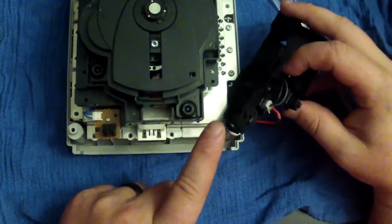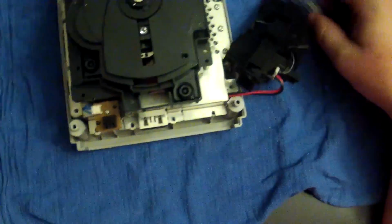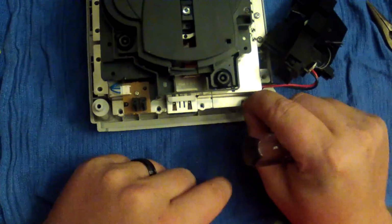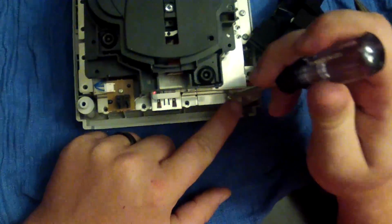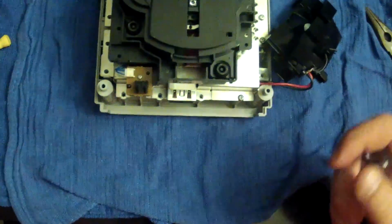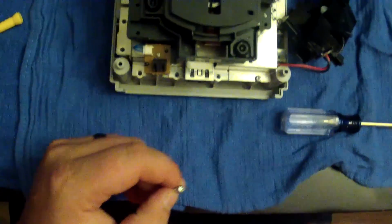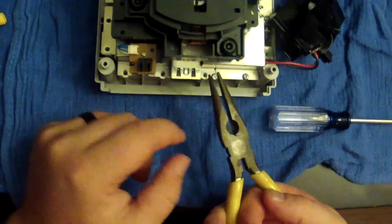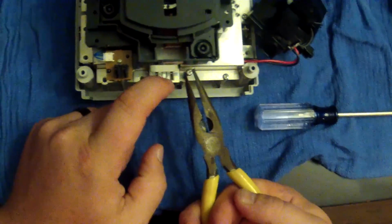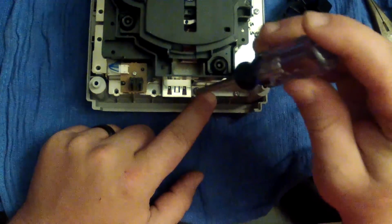If you do, your power port is going to be sitting on top of that screw, and that is going to cause a lot of headache. Trust me, I have done that multiple times like a silly Billy. So that's kind of my order of things. I go ahead and put these screws right here next to this port back here. Like I said, your needle nose pliers are kind of a lifesaver, because otherwise these screws just kind of jump.